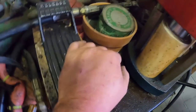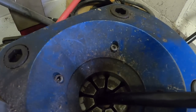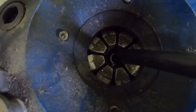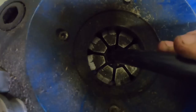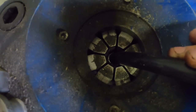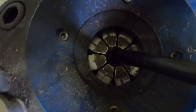Using an air compressor-powered hydraulic crimping tool to crimp them down on the cables. The air pump pumps hydraulic pressure into the cylinders, forces this red part up, pushes the wedges in, and crimps down. Make sure it's slid all the way up in there.